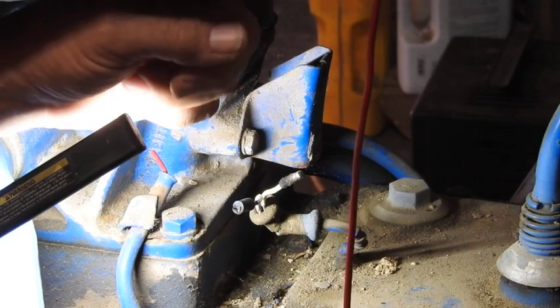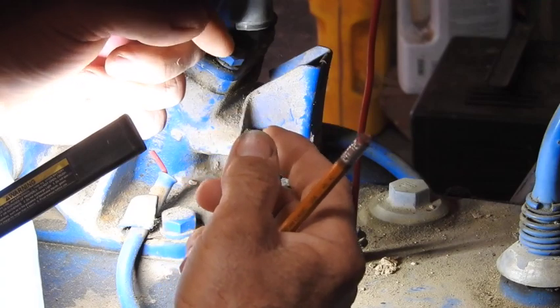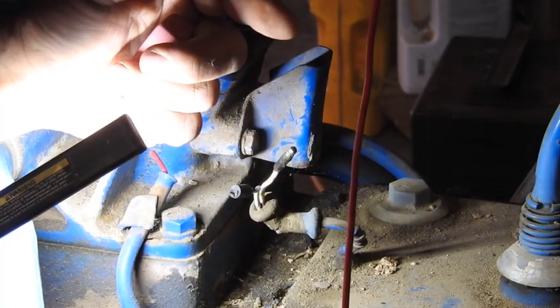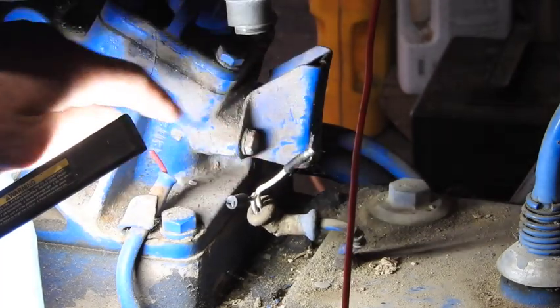What I'm going to do is pull the ignition switch out of the dash, hang it down, pull the black wire off of it, bring it down to one of these two pigtails right here, and then take the pigtail back up to where the black terminal was attached on the key switch on the momentary portion — and that's going to take care of it. Then we're going to go ahead and see if this thing will fire up and make sure everything's going to function.